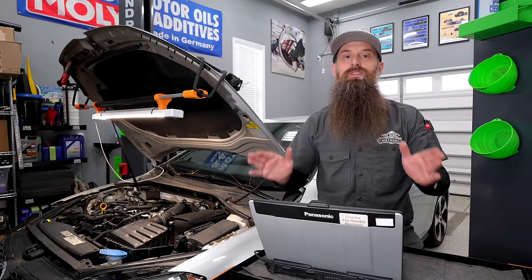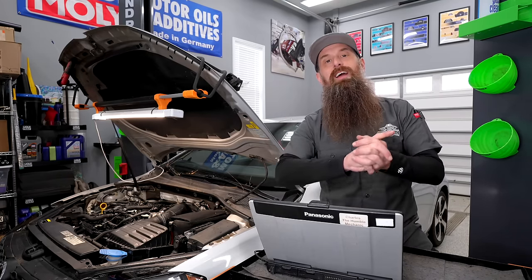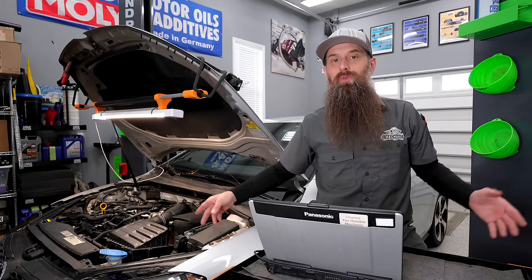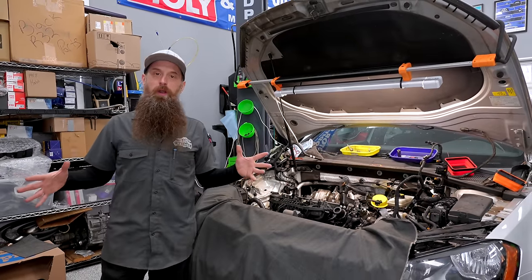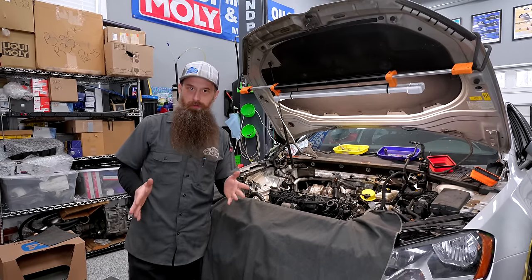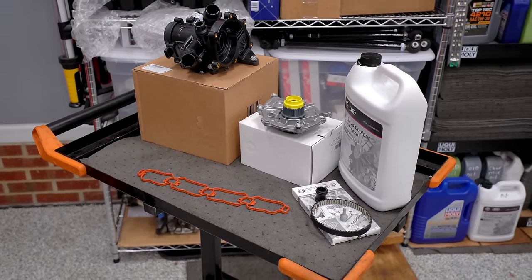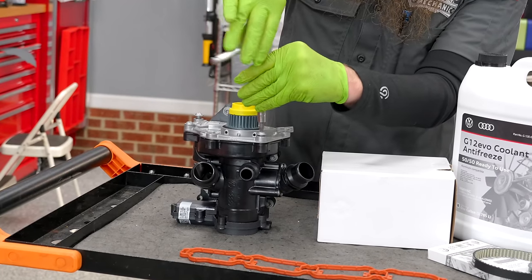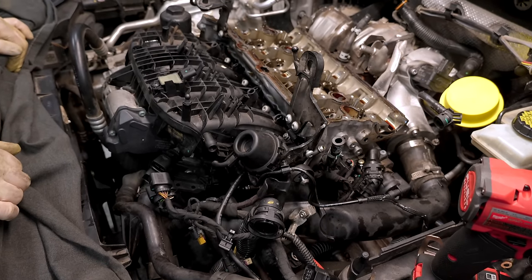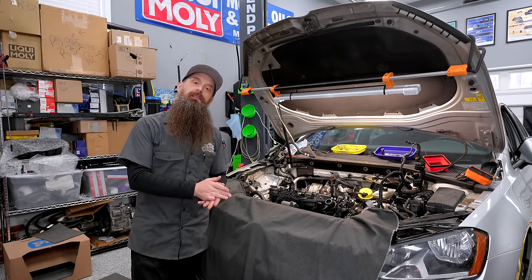It took 30 seconds at most, so it's worth the time and energy. Also worth taking your car on a test drive and keeping an eye on your coolant level. I always like to check the coolant level the next morning to be sure an air pocket didn't bubble up and leave you with no coolant in the bottle. So there we have it — a two-liter water pump. Remember, all Gen 3 and 4 two-liter water pumps are basically the same. Just be sure to refer to the repair manual. I'll put links to everything you need to do this job in the description. Have an awesome day and I'll talk to you again next time.